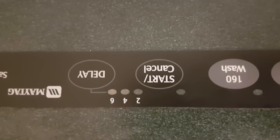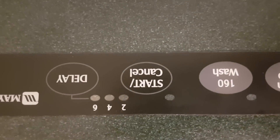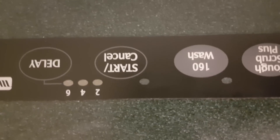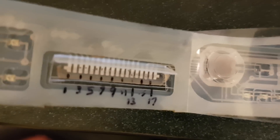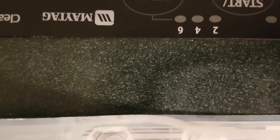We wanted to be able to access just three of these buttons, and I wasn't concerned about the LEDs. Start was a very important one — start is a connection between pin 12 and pin 13. It's a normally open connection with a 10k resistor, so when the start button is pressed there is a resistance of 10k ohms between pin 12 and pin 13.